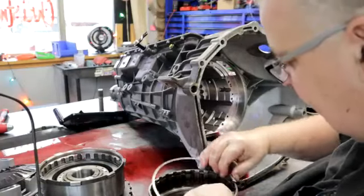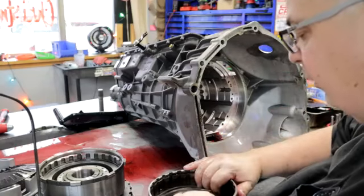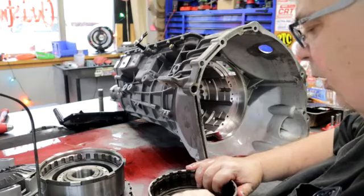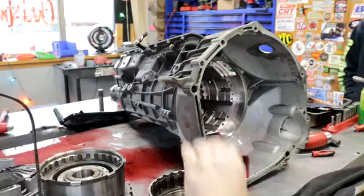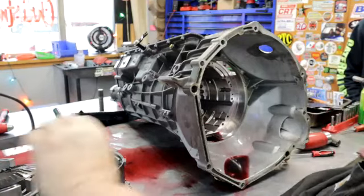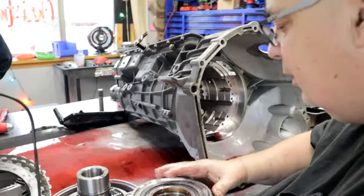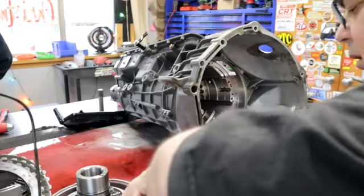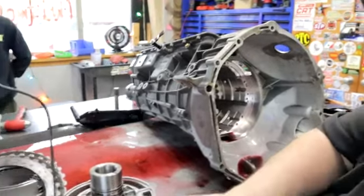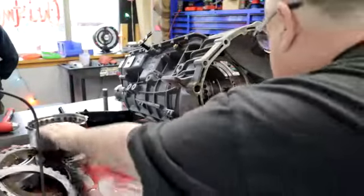This snap ring here, Lucas, could have been the wrong one. It holds the Belleville spring in. And so I think this clutch pack might have been dragging a little bit, but that's not our failure. Still haven't found anything yet. Yes, I will drive it as soon as I'm done with this. No, the sprag's still holding. That would only give it second gear issues anyways.